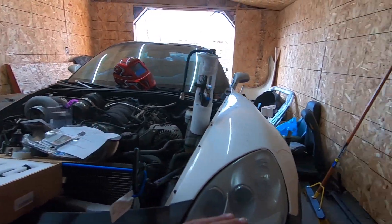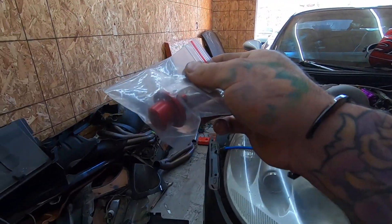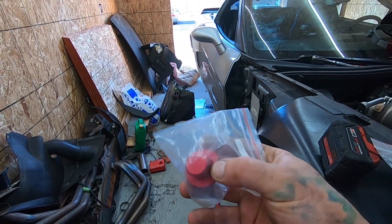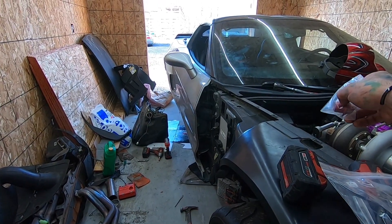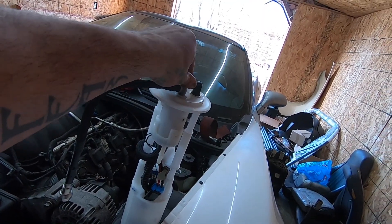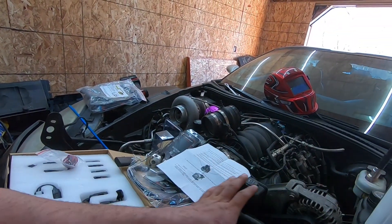We have both tanks dropped, and this is one of the big pieces that has to go in — it's a block-off that goes inside of the passenger side tank. This is what's going to block off the regulator so it still flows fuel to the other side of the tank but just won't regulate it. That's why we're going with a return-style system, and there's a return added on to this as well so we can control the pressure. When you have too much pressure going to the stock regulator it doesn't want to flow right, so that's why we're completely changing the whole setup. I'm going to get the fuel pressure regulator mounted, get the fittings fitted up, and then start running lines and putting that into the tank.